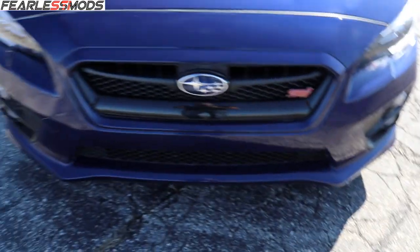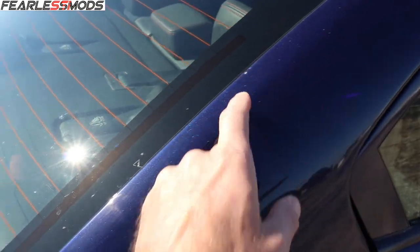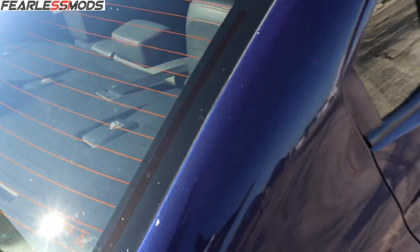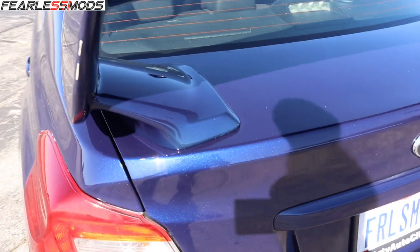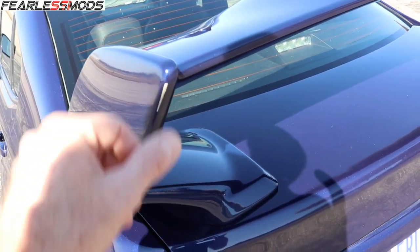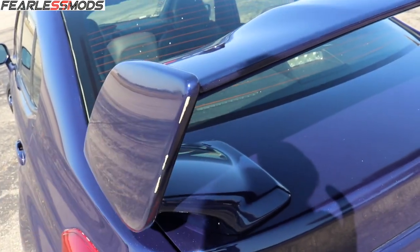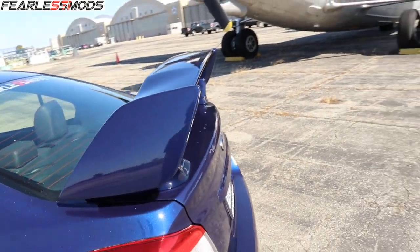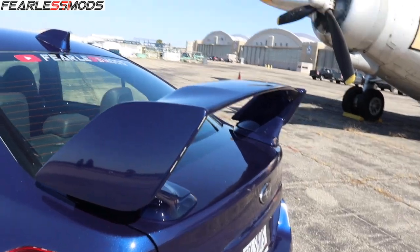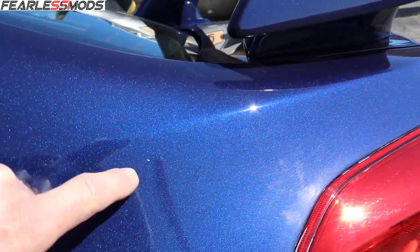Down here where there was a paint reaction it's kind of dark, but I'm not too concerned about it right now — not extremely noticeable. There are other areas where I'll continue to give it more attention, particularly where I let the wing get into the back, so I'm going to have to do some spot repairs there when I get the small airbrush ready. The lines back here look gorgeous. But here's the ugly one — I let this rub against something and it rubbed through the paint, and when I was buffing it with compound I thought it was a paint mark, but as I buffed it, it just started ripping paint off all the way down. I'm going to have to work on that. Also this little nick — I have no idea how that happened, possibly trash in the paint that the buffing wheel pulled out.